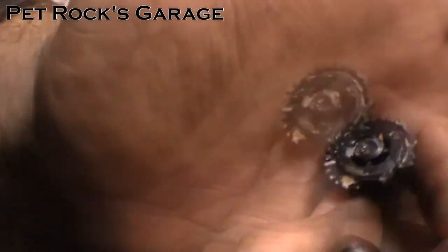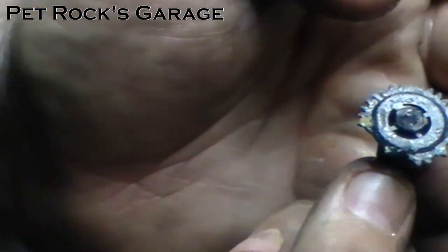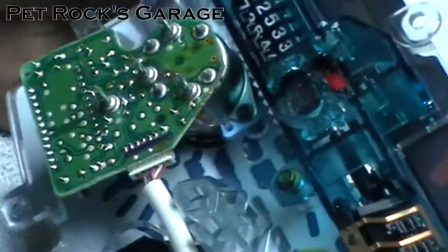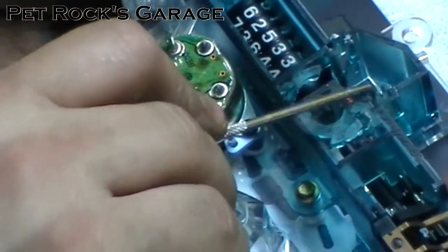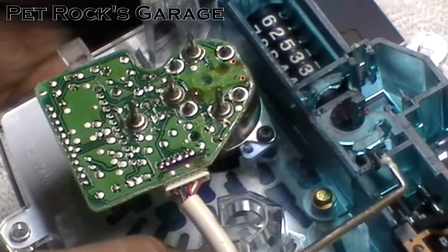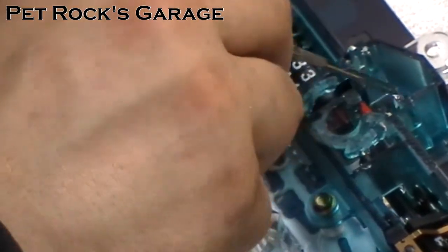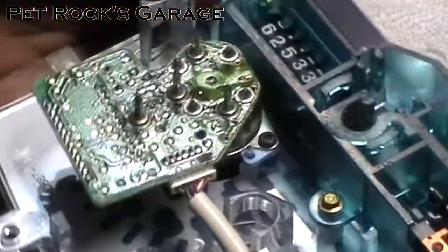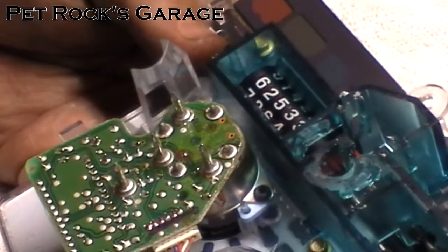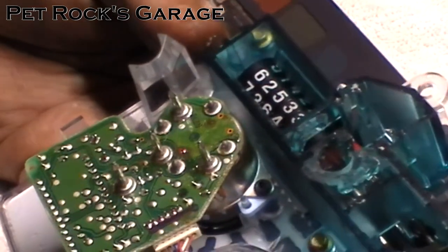You can see in my case the gear is all sorts of chewed up and even the pivot point on this side is broken, though that could have happened while I was removing the gear. Next, go in and remove any of the little bits of plastic you might find. If you're lucky there's some grease in there that might help make things stick. Inspect all the way in there and make sure you get out all the bits — you don't want an old piece of plastic getting in the gears and chewing them up again.